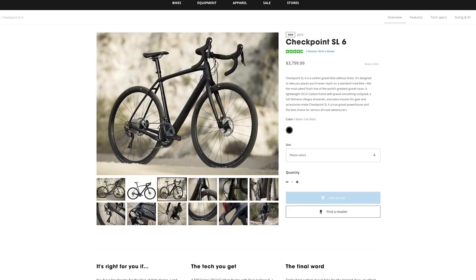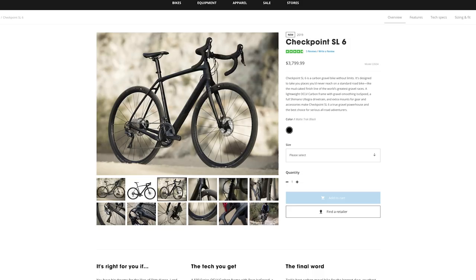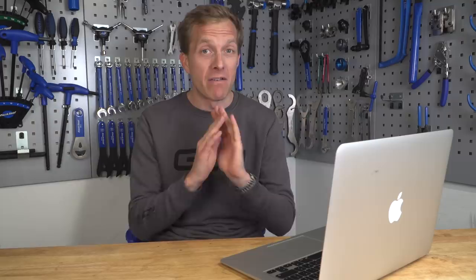Straight away with Patrick Klosterman, who asks: why is there a bend in the right-hand side rear chainstay on some cyclocross bikes? Is this for greater ground clearance? That's actually a really good question, Patrick. So for those of you who don't know, some bikes on the right-hand side have the chainstay lower than on the left-hand side, and it's not just for looks. That's going to allow you to fit a wider tire, better chainring clearance, and at the same time, you're going to be able to keep your chainstays as short as possible, without having a really long wheelbase, because the bike then is going to handle very poorly.